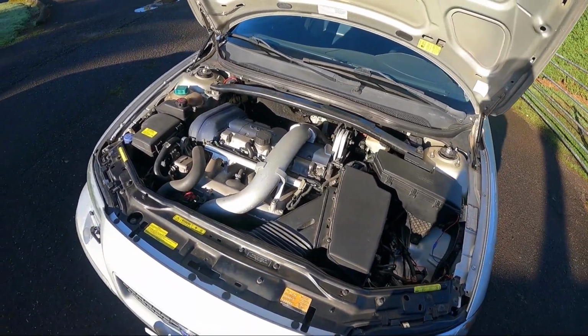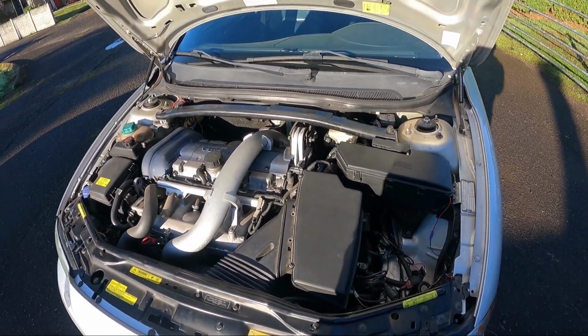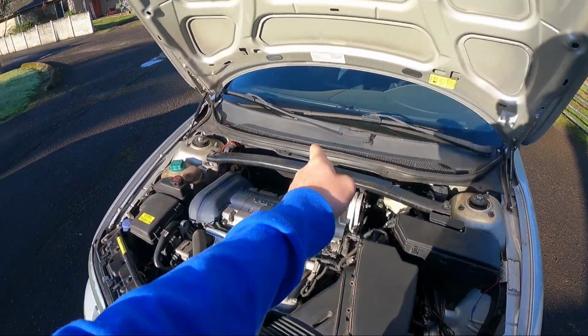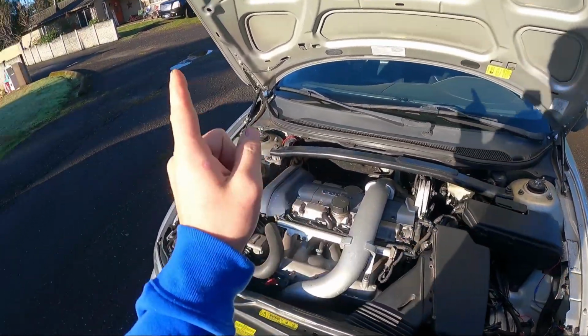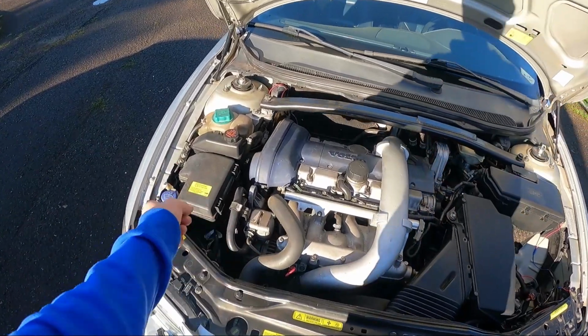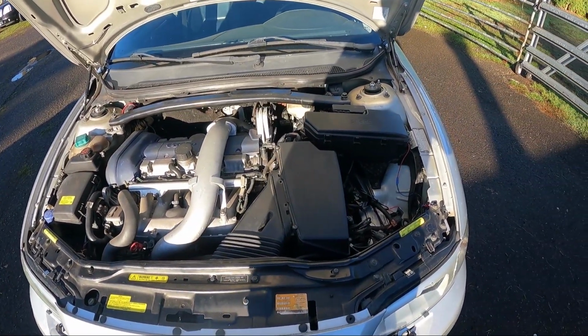So again, I contacted the XeMODeX technician, and he told me to check a few things, and then he told me to send out the CEM, central control module, and the ECM with the key. So I sent it out to them. They tested it. The CEM tested out good, and the ECM was completely dead. So he did a program transfer from my old one to this one, and I installed it and it's fine now. I've been driving it for a month.